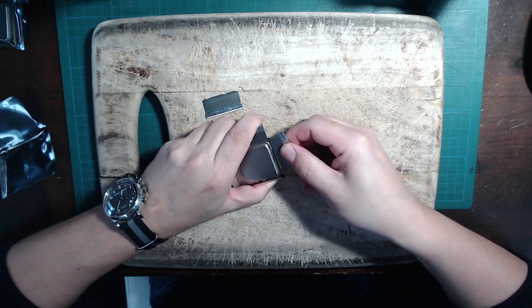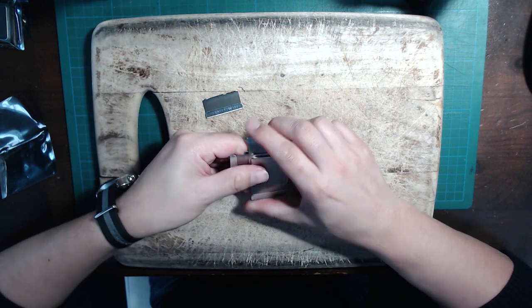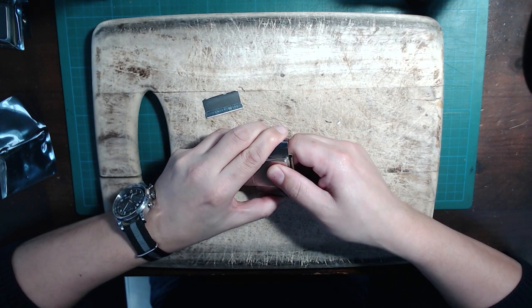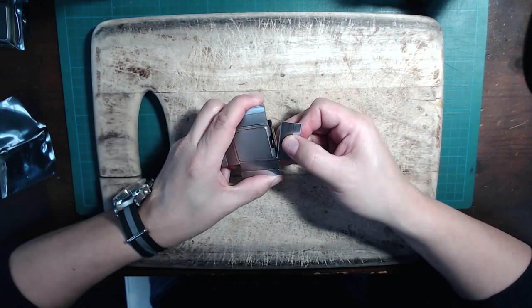Again, have a look at the footage further on in this video, pause it there to see where those capacitors are located. Once you feel that you've cut through all the silicon and you can feel it a bit, we will insert 4 of the single edge blades, one at each corner. This will provide a little bit of leverage between the CPU and the integrated heat spreader.